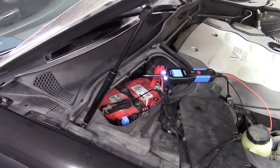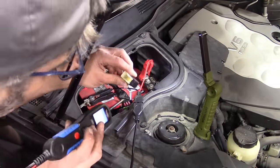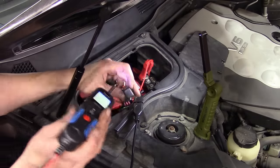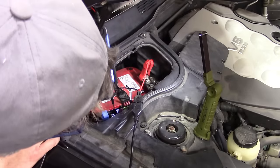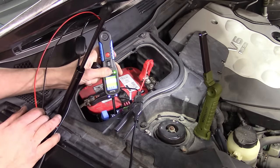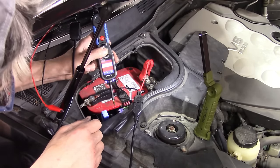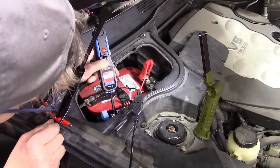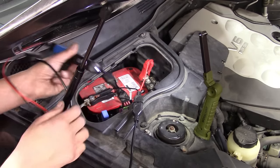It looks like we've got a relay over here. I literally have no idea what this relay is for, but if I wanted to test it we can very easily do that. There are also little headlights on here to make it easy to look at the relay map. I can see I've got 12-volt power there and identify the load side. One tip — push the button first and then touch the device so the arc isn't generated in the device, which can actually wear out the switch sooner. So we can easily test the relay right there.